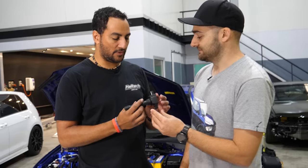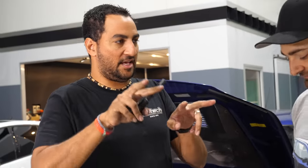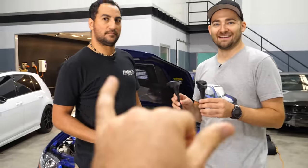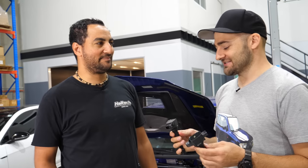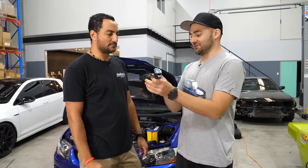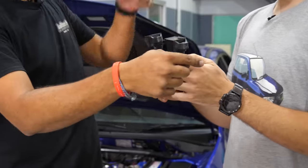So direct fire. So with the Evo, you've got two outputs on the factory ECU. But four cylinders. That runs two coils. Yep. And they're shared and paired as they fire. And if you put them the wrong way around, the car doesn't work, like, Dave. Like the other day when we put them on backwards. Oh, right. And then wondering why it sounded like rubbish. But that's exactly what it sounded like. You've got two of them, except you've got a coil with a wire that comes out. There's a little lead that comes out and goes there, and this one has a little lead that comes out this way.